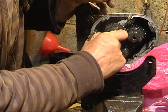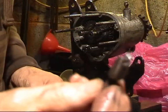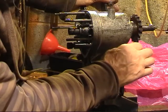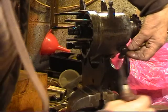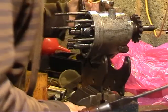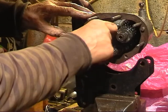My shim washer actually should give it a clearance of about five thou on the lay shaft. So now I have to put the little retainer - selector fork control mechanism - that has to be locked into place, so put that back in there. It should go down some way actually. Perfect, that seems pretty good. Right, gasket in place, thrust washer in place.